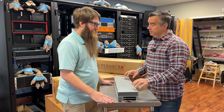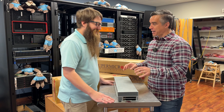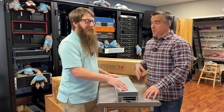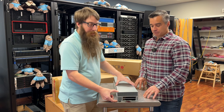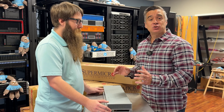We've got a 200 gig InfiniBand switch that's going to provide the internal communications of the blades as well as provide high-speed access externally. If you need something more Ethernet-friendly, we've got two 25 gig switches in this as well, and then there's a management module that we'll get into. There are also 3000 watt power supplies, but before I continue telling you about all of these things inside, let's get all this open, rack this bad boy, and get to work.